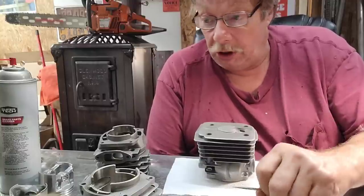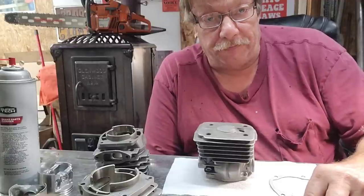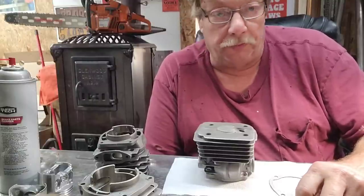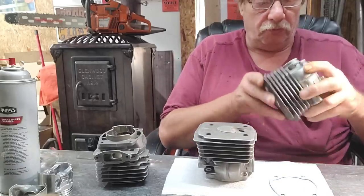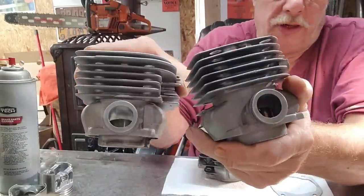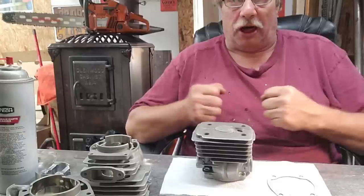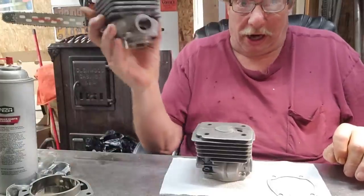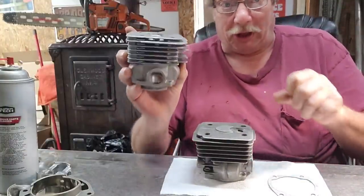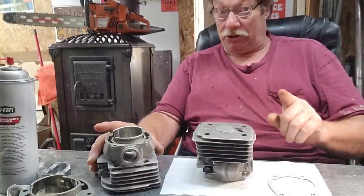I hope I'm helping you. A good friend asked me the other day: 'Arv, can I use a 390 intake boot on a 372 because I want to put the 390 carb on?' No — can't do it, because the 390 is bigger OD than the 372. Something interesting though — with this build you can stretch out the intake boot of a 372 and get it on a 390, but your clamp is going to be at the last thread. 390 intake boots are not cheap; 372s are easy to be had.